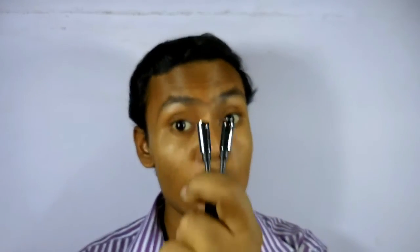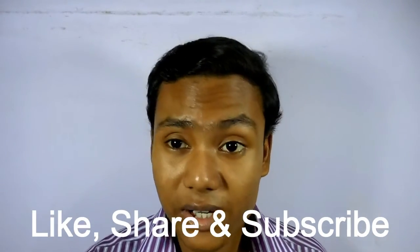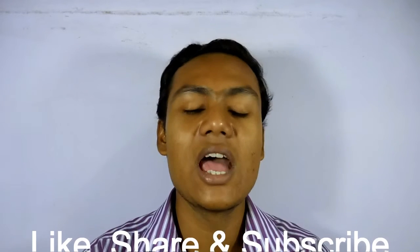Let's say we want to use our mobile phone like a digital voice recorder and want to use an external microphone — in that case we can use this TRRS connector with our mobile devices. Or let's say we want to use a PC-style headset that has two separate 3.5mm plugs — in that case we can use this type of connector with our smartphones. Basically, a TRRS connector is an audio signal separator. That's all for this video, see you next time, have a nice day.